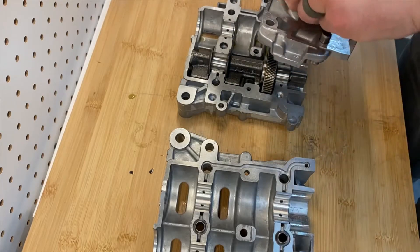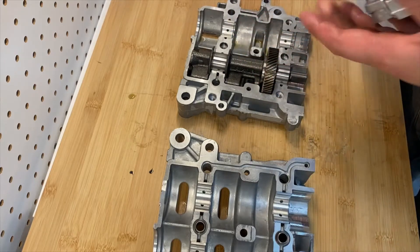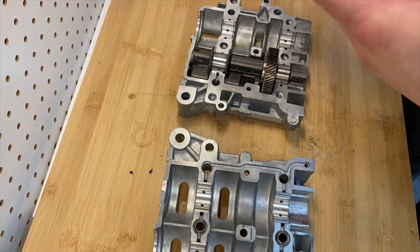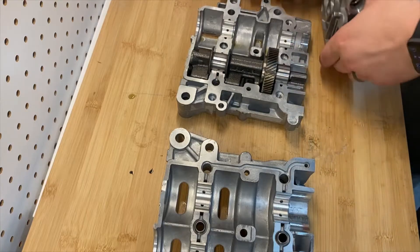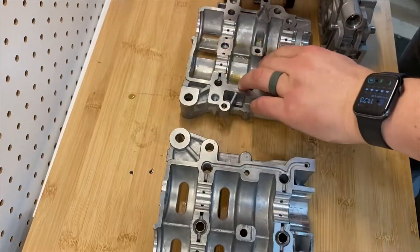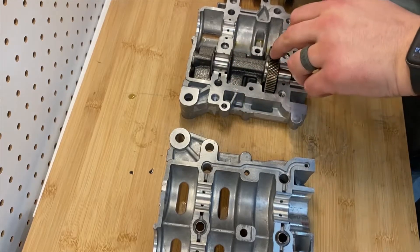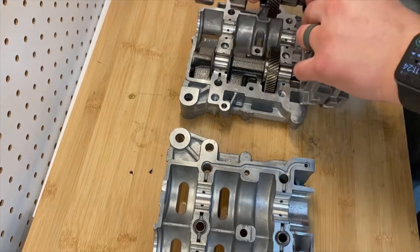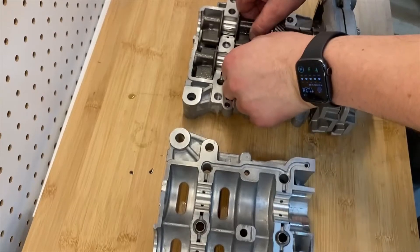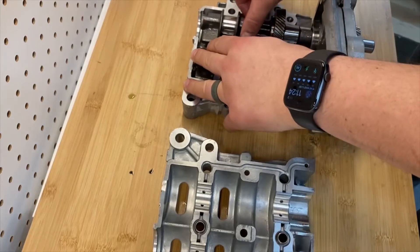When going back together, we're going to reinstall the drive gear. Let's get this pressed back together. When rebuilding this, you want both sides to be parallel with each other. There are no timing marks on these gears, but you want to keep your counterweights flush with each other. This can be a little bit of a pain, but make sure you get them set in there correctly — if it's not parallel, that's incorrect.